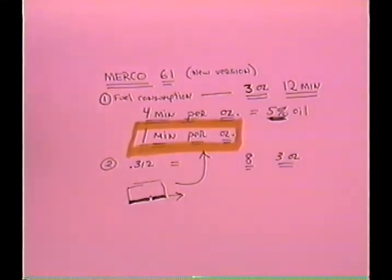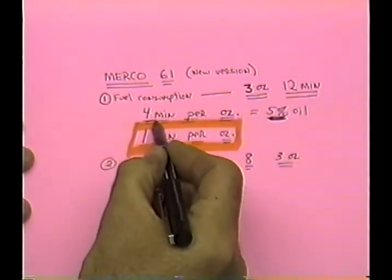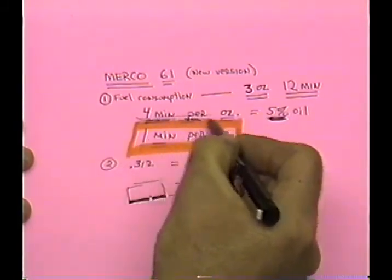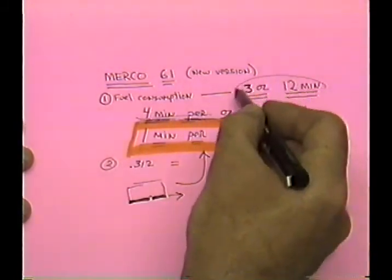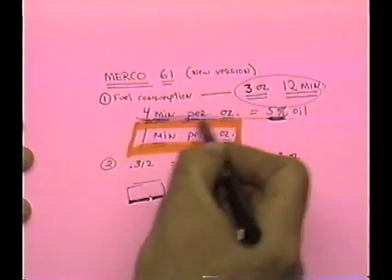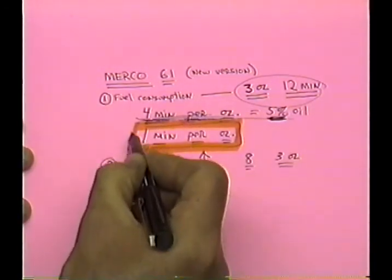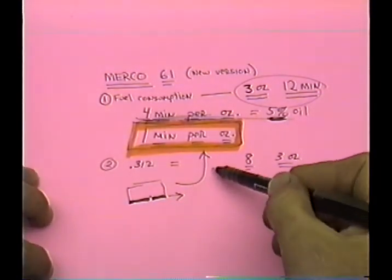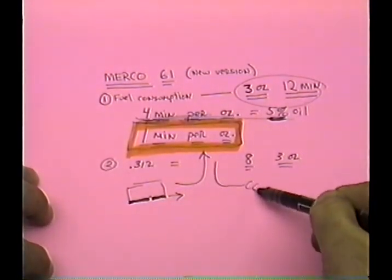Again, if you get a motor with a little tiny Venturi and real low compression, and it's running forever on fuel, you want to get it down to where it's using, I think a good starting point is 1 ounce a minute. And that lets you know that enough alcohol is going through the motor, cooling it.